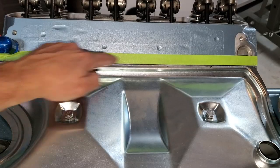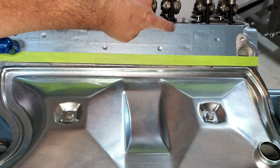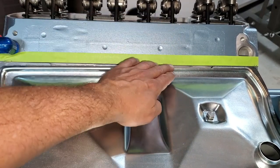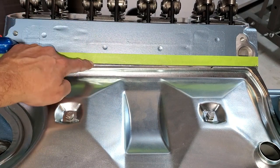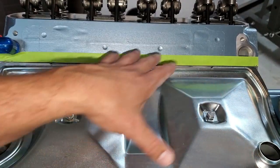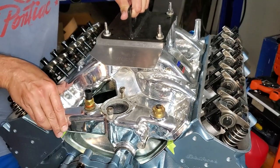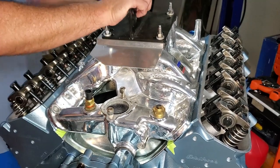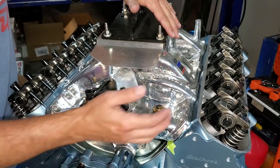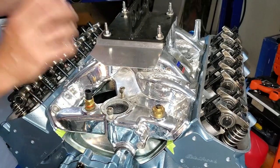Here's the fix. I added further relief where the intake manifold comes down, and it matches the top — there's the top of the gasket, there's the bottom of the gasket. This one I extended a little bit further back, but this one matches the top cutouts. Did the same thing on the other side. Let's go try this again — take two. Perfect fit. I can tell right away. I intentionally did not put the gasket in there because I still want a little bit of clearance, so we are good to go with sizing.